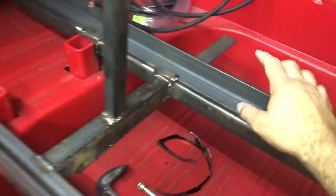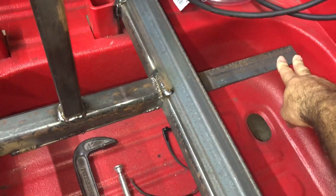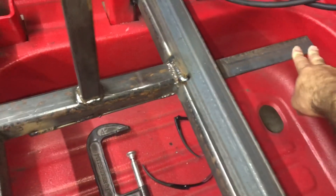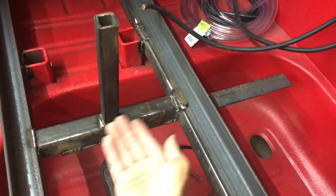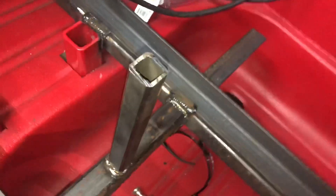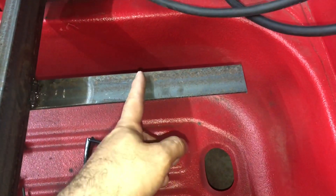Small continuation on the rack here. Before I painted, I welded in the brackets for the actual pump. All it is is angle iron, and as you can see I started it from way back here and it's welded right under this cross-section all the way through. All that's left to do to that piece is to slot it for the pump right here, so I'll drill holes about right here and right here and then I'll slot them.